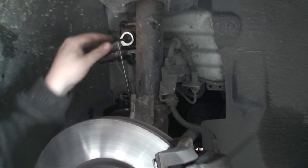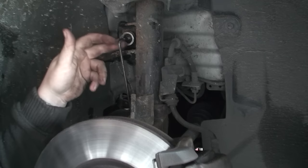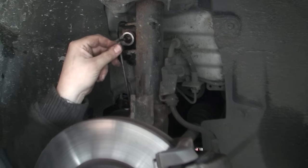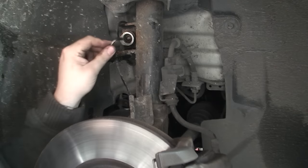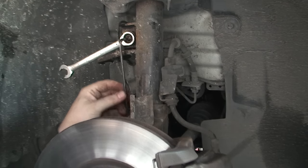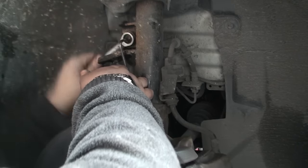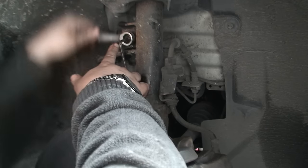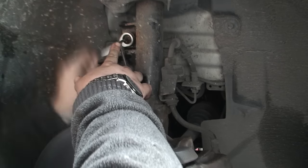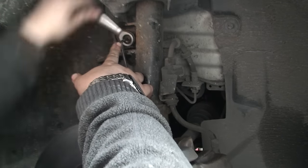I'm going to disconnect the drop link and the shock bolt. To undo the drop link, because it's an old one, if you put the air gun on it the whole thing spins - no good. So we have to put a number five allen key in the hole. I put the allen key against the shock so I don't have to hold both, and literally get a ratchet spanner and undo it this way. It's important to get the right size allen key in, because if you round the middle of that you'll never get this off without cutting it. The 15mm bolt on the shock just came out really easy.